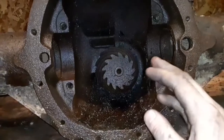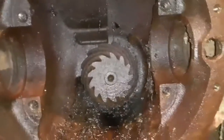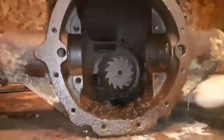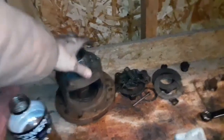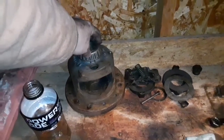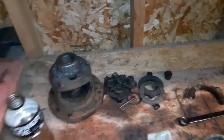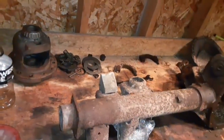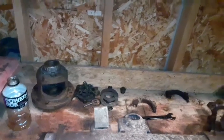That was a mud line — it's full of dried mud and dirt. The pinion is almost locked down; if you grab the back of it you can move it a little, but it's not going to rotate. The reason I bought spider gears is I came up with this 3-series carrier posi-traction unit that was missing the gears but had the clutches and plates and all that stuff. So I found one of those cheap Dyna-branded replacement kits for that posi-traction unit.